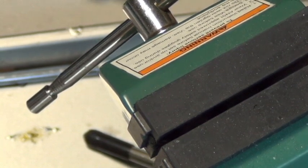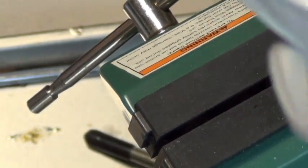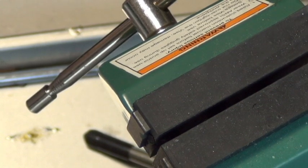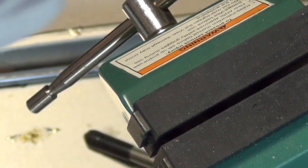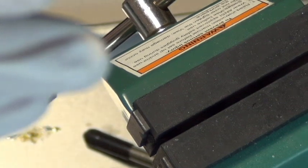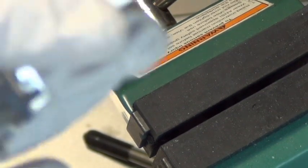Oh, and also for those of you, do not buy flux from Home Depot or plumbing supply, because that flux has active ingredients, zinc chloride or something, that can make hydrochloric acid when you heat it up, and that will destroy your logic board or whatever project you're working on, because hydrochloric acid is very acidic. It's not like the flux I'm using in this video, which only has a really weak acid. Hydrochloric acid works much better as an activator for flux, but it will eat away your logic board and make it really corroded. So don't use those flux either. The plumber flux is not good for electronics. It's not friendly to electronics.